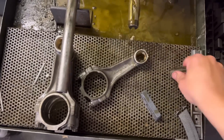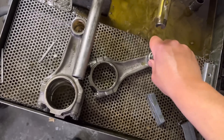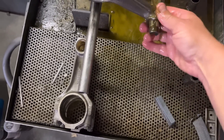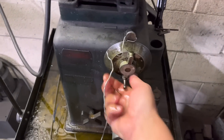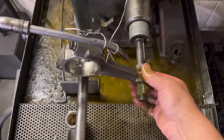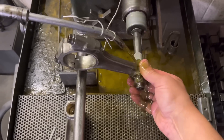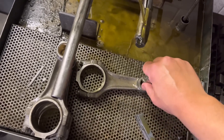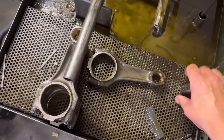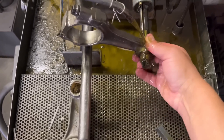And every now and again we've got a pin here - this is the Cosworth pin. We try it in the hole and you keep turning the rod round, and you put a half a turn cut on there, forward and backwards, three or four times. And then you can normally feel when the pin starts to go in there. It's hard to explain on video really, but it's just a case of feel.